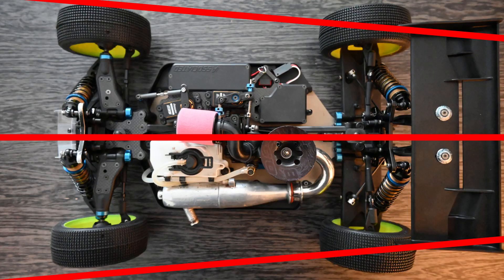If you would have toe-out on the other hand, this would mean that both of the tires would want to go out of the car — both tires would want to drag the car in some other direction. Then if you would have more force on the inside or the outside tire, it would mean that the car would go that way. So with toe-out the car would want to go different directions all the time, while with toe-in it always wants to go straight, as the tires are pointed more towards the center line. This is sort of the basic principle of how toe works.